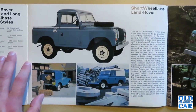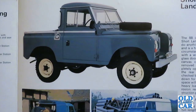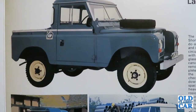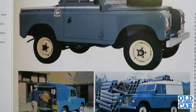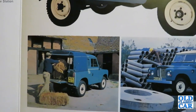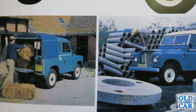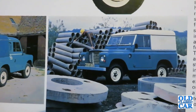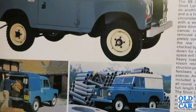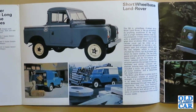Here we have the short wheelbase version. The 88-inch wheelbase, four-wheel drive short Land Rover is the go-anywhere, do-anything workhorse of the range and is a high mobility vehicle under any circumstances. In basic trim it is provided with a weatherproof canvas hood and glass door windows. The canvas cover can be rolled up or removed altogether to provide a completely open and compact vehicle, and the rear tailgate can be dropped right down for easier loading. The rear body space will take all kinds of awkward and heavy loads and its non-rusting aluminium alloy construction permits the carriage of manures, fertilisers and similar corrosive substances. Among many body options are a truck cab and a detachable full-length hard top.